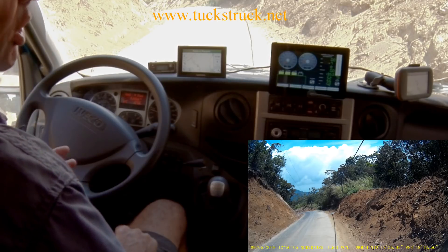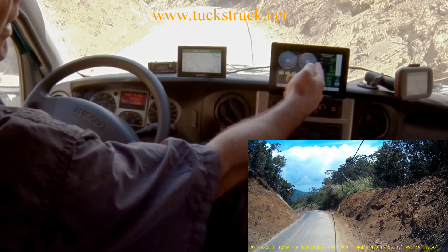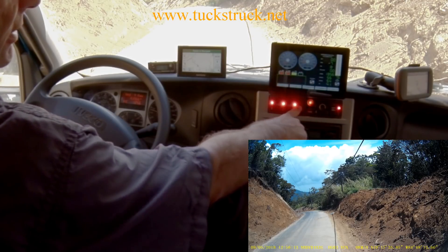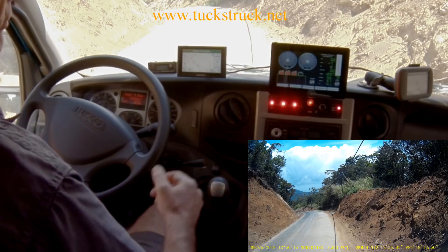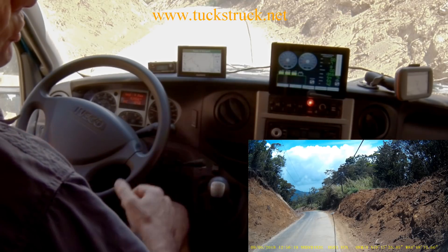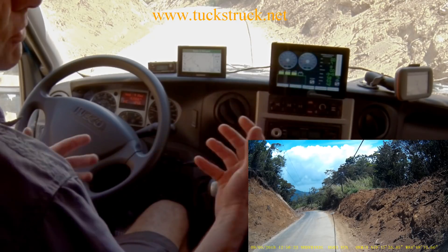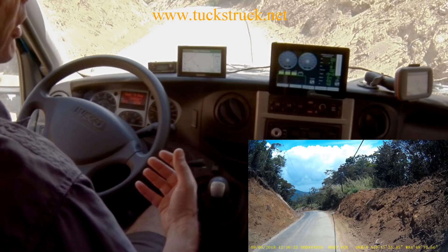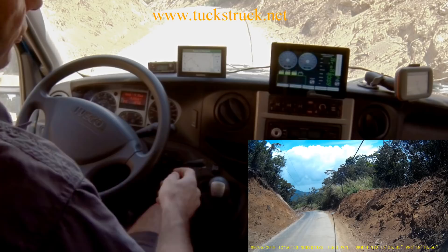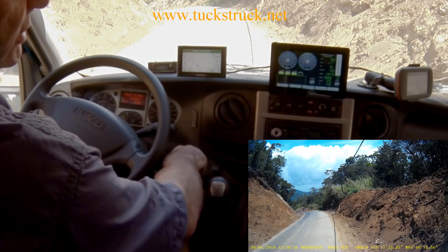My central display — hopefully it'll show up a little bit better on the video. I have speed and engine RPM. I also have the diff lock controls in there, just showing the selection of the locks when required — I shouldn't be using those on the hill. We have the retarder temperature. Because it's a magnetic retarder, when you put the retarder on it produces a large EM field which affects the thermocouple I'm using.